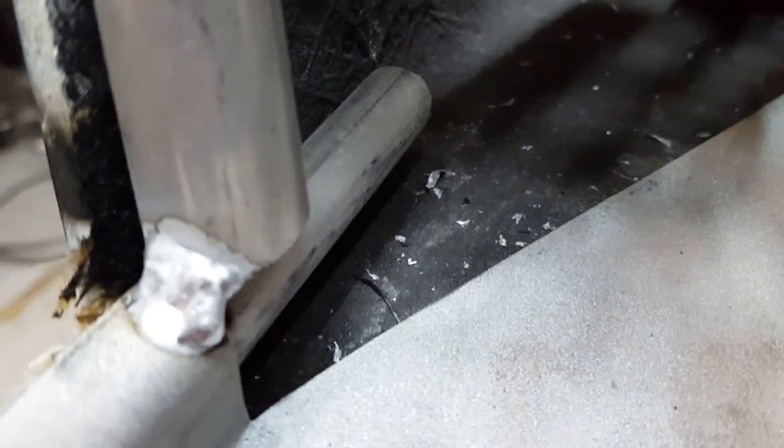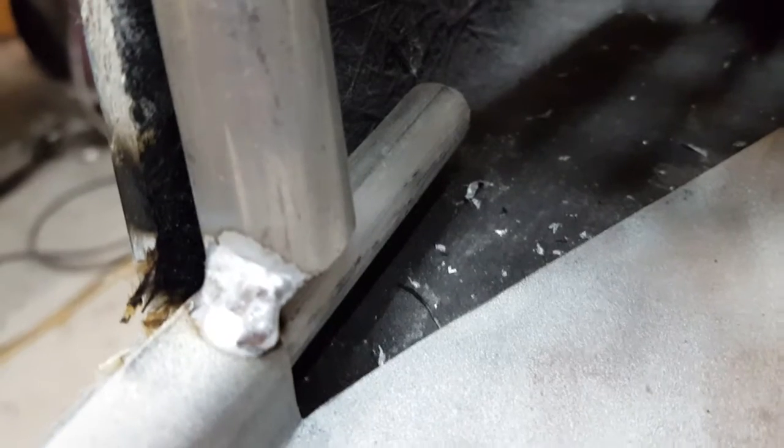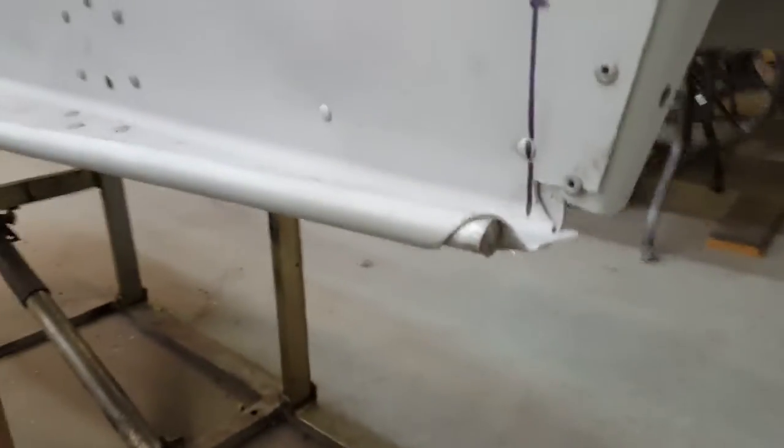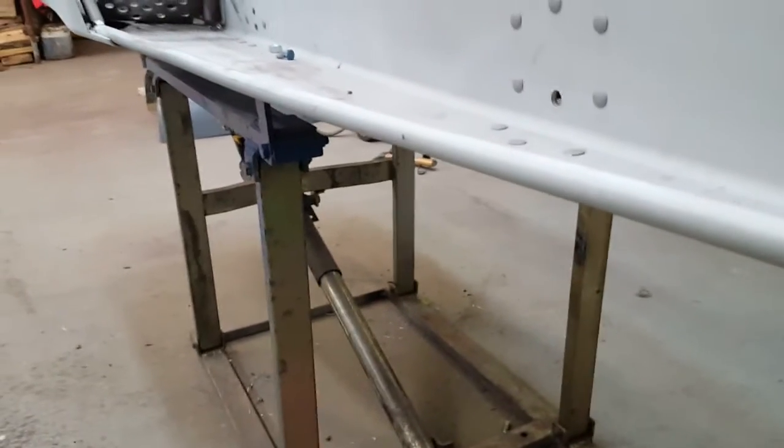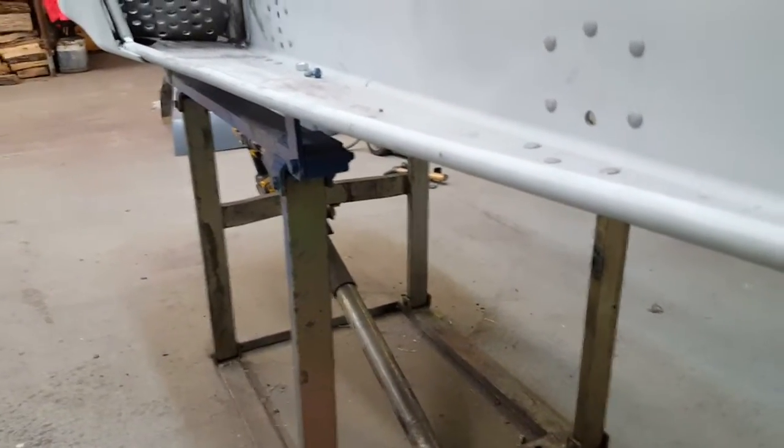And then when I had the belly pan off, there's a piece of 1/2-inch aluminum rod that I pounded down the whole length of the edge of the running board, as these things were kind of weak. So by pounding that down, I always do that on all my sleds when I restore them or modify them, whatever. But you can see it sticking out the end right here because I drove it all the way down through the running board. And it really helps add a lot of extra strength to these running boards by doing that.